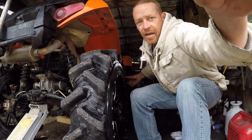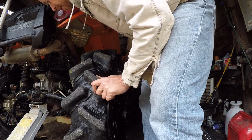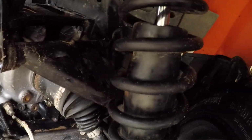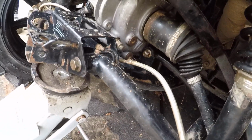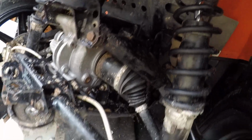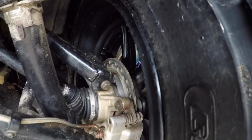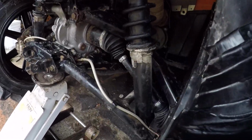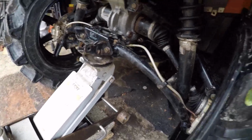What this is now is the A-arm bushings and sleeves. Those sleeves, those metal rods that run through here, it's not just the bushings you change, it's the rods too, and they're different sizes. I just had enough to do the top because tops are the smaller ones and my whole bag is full of smaller ones. So now it's just, see if I can show it to you.